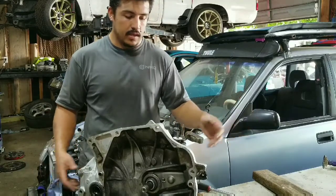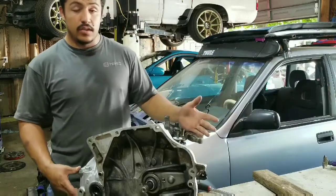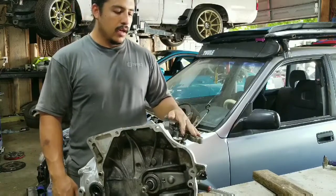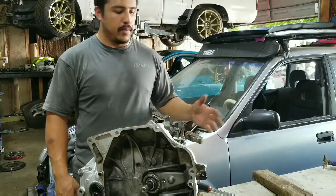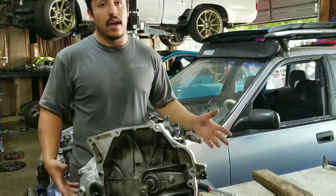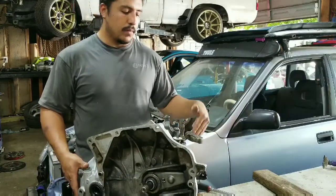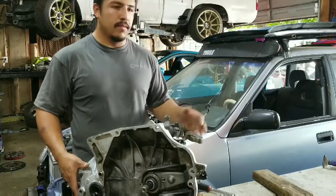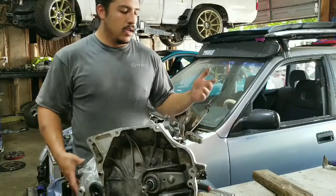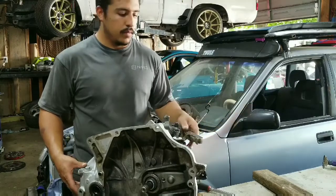If not, it's always nice to be able to let someone know, hey, there is a way. Obviously you just have to split the tranny. It's probably not the most convenient way for a lot of people, but to me it's the best way, because you could always go back and forth after that if you want to put it on an 06 Civic, or put it back into a swap car, for example an EG, with the 02 to 04 ECU and engine harness, which is the most common one people use.